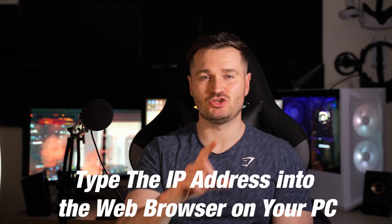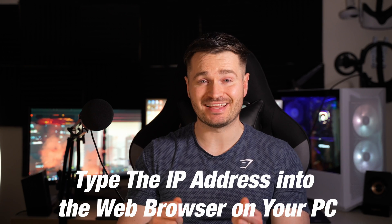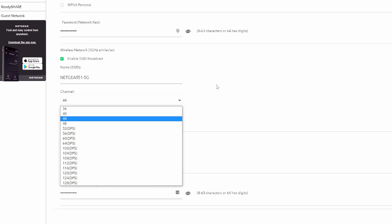After doing all that, my application still said wireless PC streaming content may be degraded, so something wasn't perfect. There was one extra step I hadn't accounted for. Log into your router settings by typing your router's IP address — found on the back of the router or the box — and log in via the admin settings. Scroll down to your 5 GHz option and you should see a channel selector. There are many channels available but they're also open to your neighbours, so you want to find a channel completely free of interference. Use a NetAnalyzer app to identify which channels are congested, or run a speed test across different channels to find the best one.